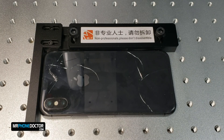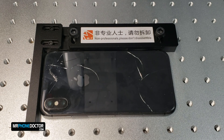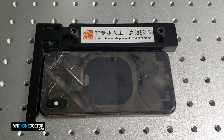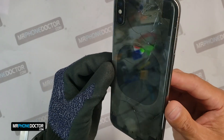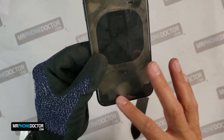Once we have a solid green light, that means the focal point on the laser is ready to go. We can now go ahead and lay the device onto the laser section. Now that we have adjusted the galvanometer, we can go ahead and begin the laser removal process. Now that the laser has completed its first pass, we can go ahead and carefully remove the broken glass.